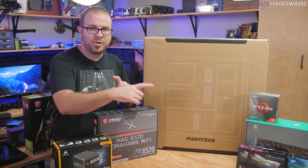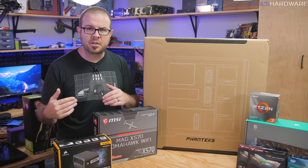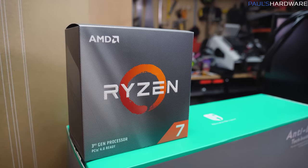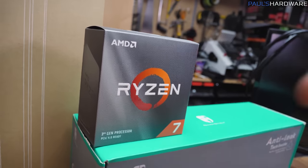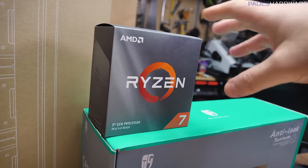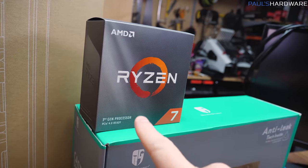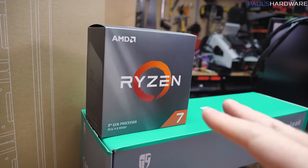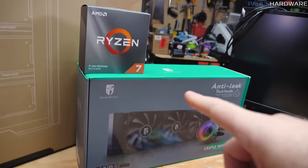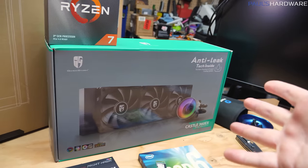I'll point out a few areas where you could shave the price down pretty significantly, getting it towards the $2,000 range. Our CPU did not ship with a cooler because the 3800 XT is the fastest, so they assume you'll go with an aftermarket cooler. If you want something less expensive but still want 8 cores and 16 threads, the 3700X should be around $300 or less, and that does ship with a cooler — saving you another $150 or so by not going with an all-in-one.